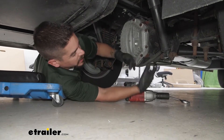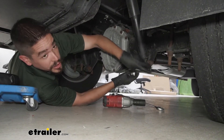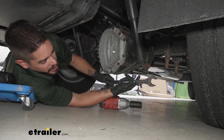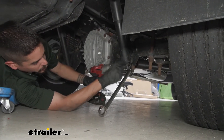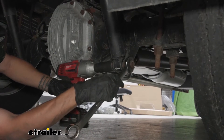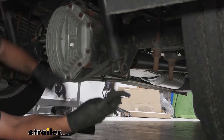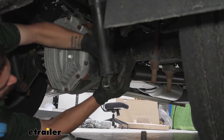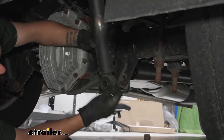If we move to the back side of the rear axle, we'll find our shock mounts and the hardware that's holding our shocks in place. We need to pull our lower shock bolts out so we can get access to behind it, because we have a couple of holes on this shock mount that we need to get to. We're going to grab an inch and one-eighth socket and an inch and one-eighth wrench and pull that bolt, nut, and hold on to all the hardware. You want to make sure you hold on to the bolt, the washers, and the nut. Then once you have the shock loose, just grab it and push it out of the way as much as you can — or just turn it so that you can get access behind the shock.